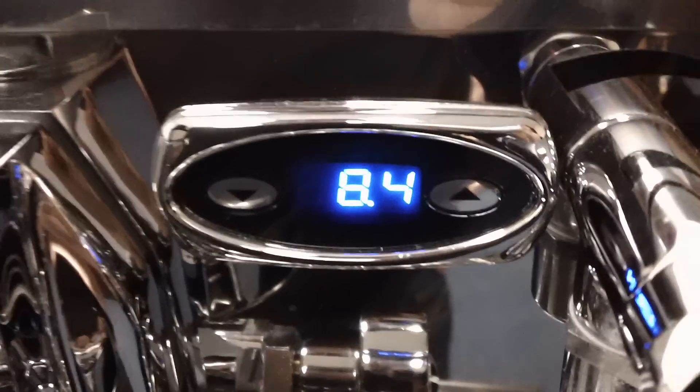That's a simple walkthrough of how to quickly change temperature on the PID for the Alex Duetto. If you go deeper into the settings, there are a lot of different settings you can change — like the amps, which you can change between 15 and 20 amp. You can also change the program offset differential and many other PID settings. If you want to know more, we'll have the full menu below this video in the blog, so check that out.